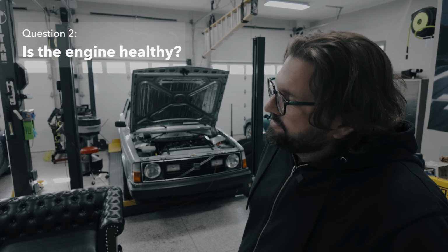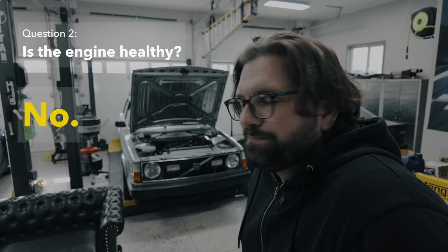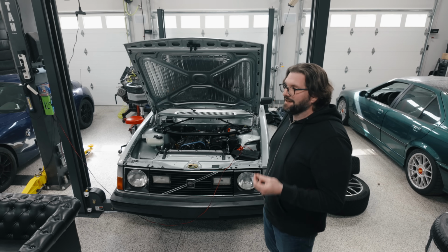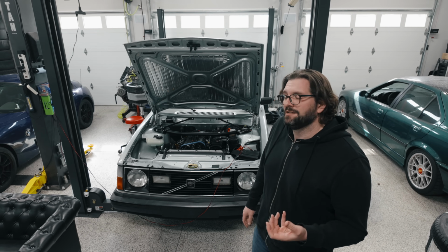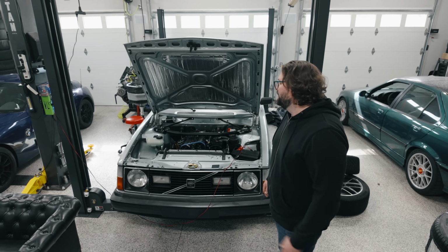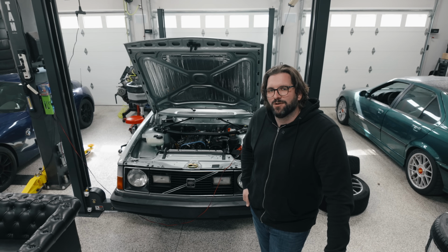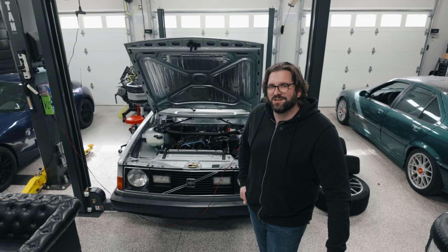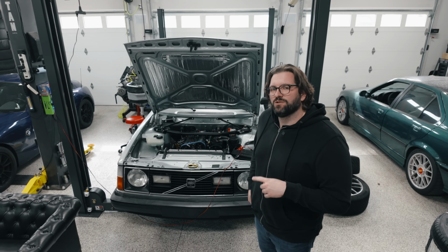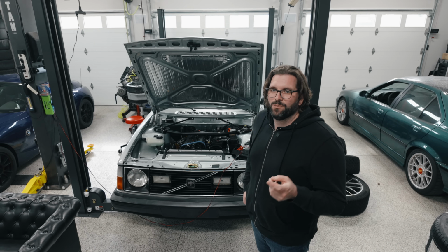If this car stays 5-cylinder powered, that means finding a replacement engine for it. Now I know it wasn't valve train noise, it wasn't the hydraulic lifters needing to pump up with oil and the cams just kind of beating into those lifters before they got pumped up. It was foreign object damage. I don't know where that would have come from, but there's only one spot on this car that has an object like that. So I'm gonna check real quick and see if that's still in place or if that came apart, and then we'll talk about what that is.